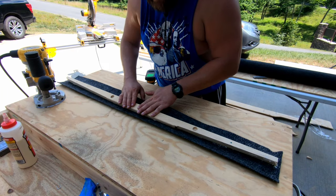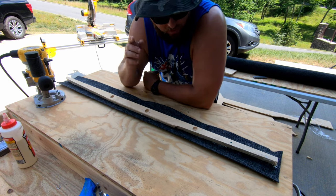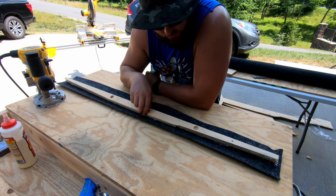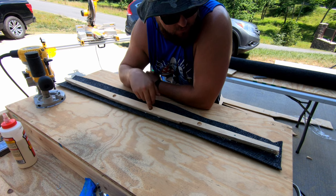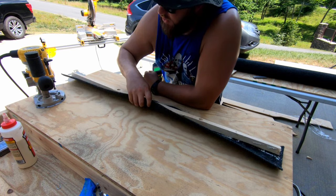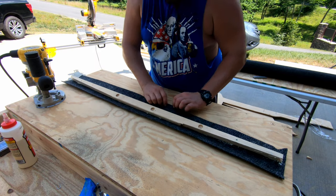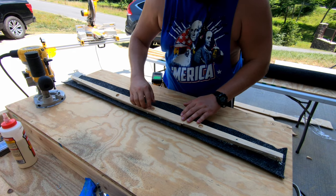This is the top board furring strip that's gonna go above captain's chair, passenger chair, above the head. I got this all chopped down to size, had to do some angle cuts with the circular saw, counterbore for three self-tappers, and this is the charcoal gray trim out carpet that we're going to work with. This stuff stretches really nicely, so it's going to help round turns and stuff.